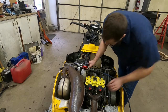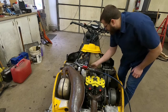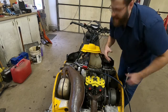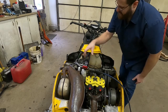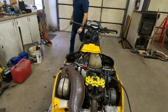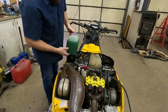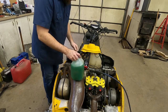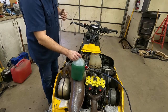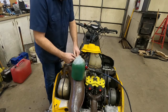Now snap-on wants you to leave it there, and if you look — you're not going to be able to see it — but all my rubber hoses and everything are collapsed because of the vacuum, and that's going to draw the coolant down inside. So I've got my mix of coolant. This is like 60-40 — with a snowmobile you usually mix them a little bit more than 50-50. This is my 60-40 mix.